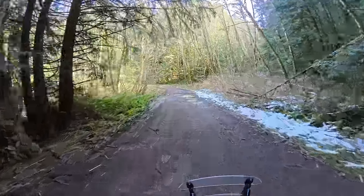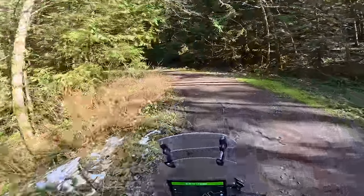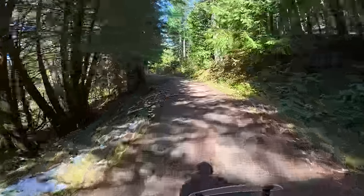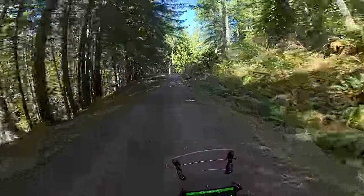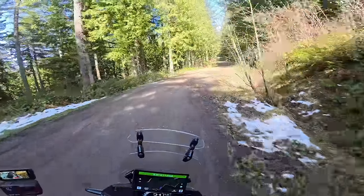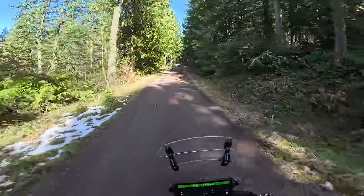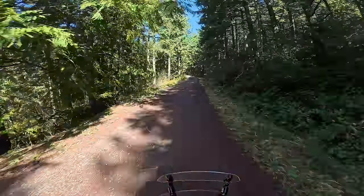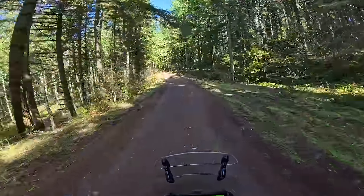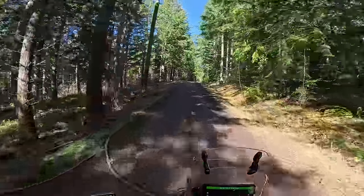Oh man, this is a big difference. I can already tell. Oh yeah. So much more resistant to bottoming already. That was the big thing with this stock suspension. It's just really street tuned. So I didn't spend a bunch of money. Paul did a new spring and he went in and reworked the internals. And he actually added, so this only had like a spring and one fork. So he went and put in some springs from a 300L that he just had. So that worked really well to stiffen up the front, which I like because that's what hits the bumps.